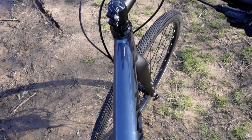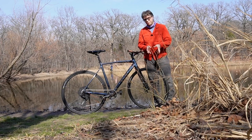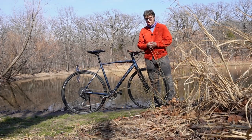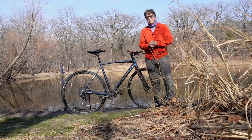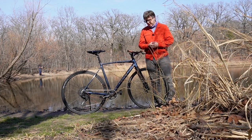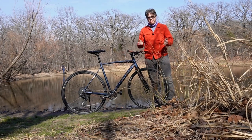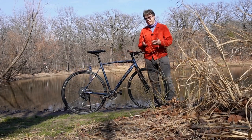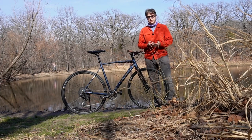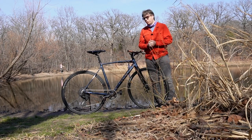Moving to the front of the bike here — this is actually one of the parts that took me the longest to figure out. The front wheel was out of true when I received the bike, and that's part of why it's been a month since I started the assembly process. I had to learn how to true a wheel. Those of you who know how — it's not a very difficult process, it just took me a while to wrap my head around which spokes I needed to tighten and which I needed to loosen. I even sent out an email to Poseidon Bikes saying I'm having trouble with this front wheel out of true. Poseidon Bikes was very helpful — they told me if I took it to a local bike shop and sent the receipt in to Poseidon, they would reimburse me for whatever the truing cost. However, as soon as I got that email, I had just trued the wheel myself and it now rolls smoothly and straight.